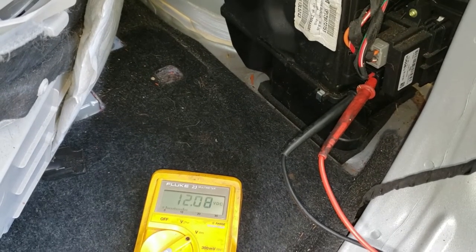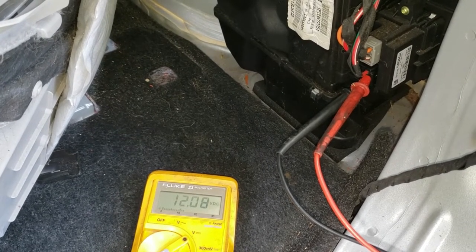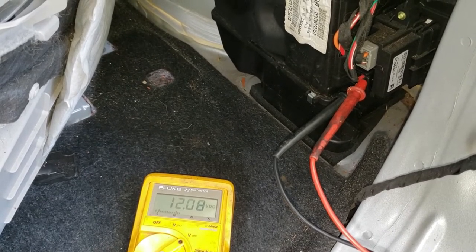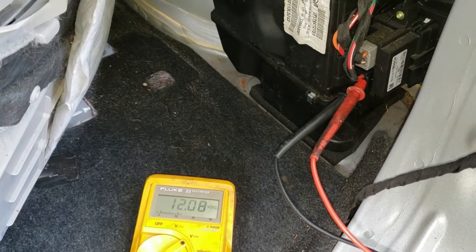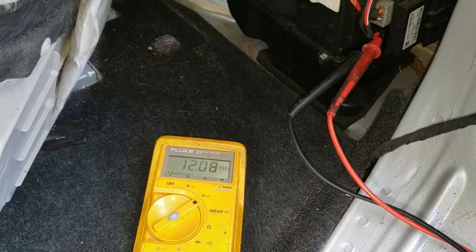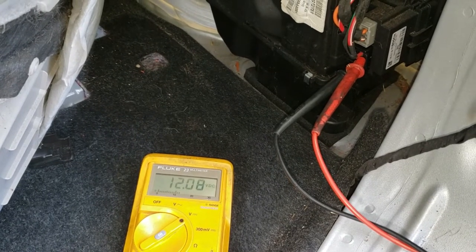But that's not the issue we're having. We're having a problem with sometimes the blower works, sometimes it doesn't. I've already figured out what's wrong and I've actually partially installed a replacement blower motor because that was the problem. I mainly did that so we can get to the wiring easier to show you how we actually have to test everything. We're back here to the basic power and ground going to the blower speed controller — those are the ground input and power input.